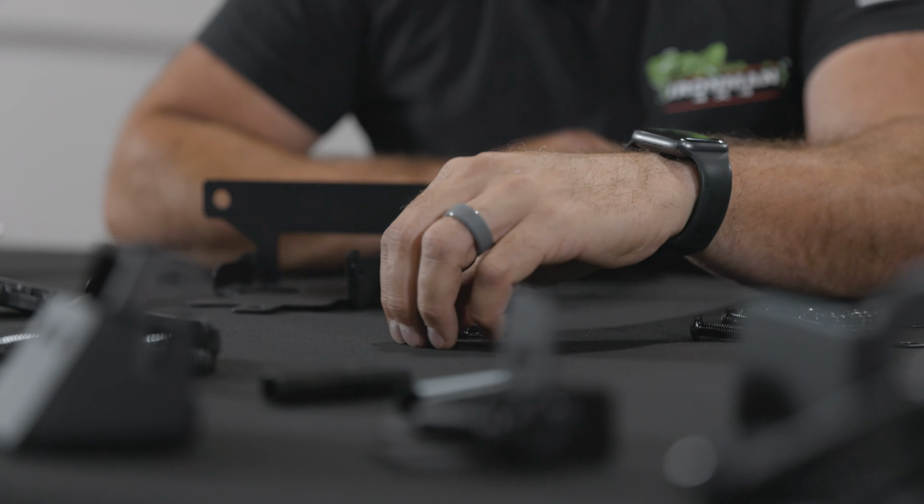Cool, we'll do the other side. All right, with the headlights on, we can put this lower body trim piece on. This is all held in place with clips, so just line it up. There's a locating pin right here, kind of off to the center and the left. Just a little bit of pressure to pop those in.